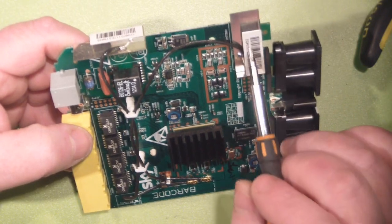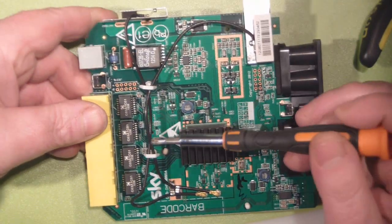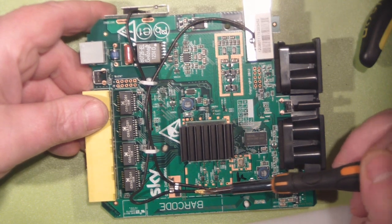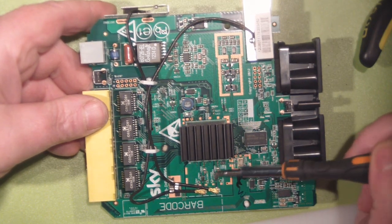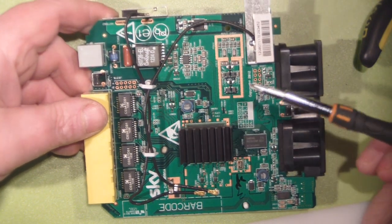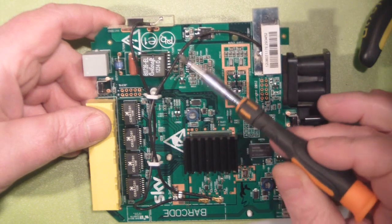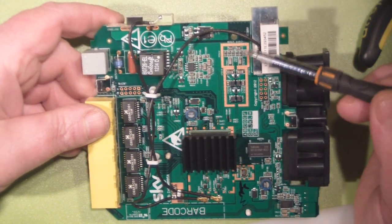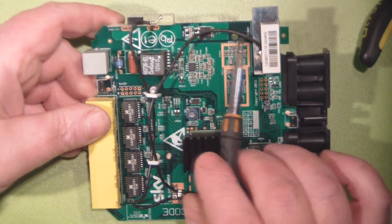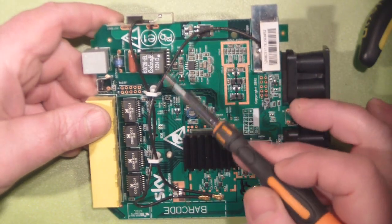You've got one in the horizontal and one in the vertical, so you're supposed to keep it that way up. The good thing about this is you've got your two U.FL connectors here, so we can just disconnect the LMR cable that feeds into the actual chip under here that performs all the Wi-Fi. We can just take them off and desolder them off these antennas. Then we can use this cable to either crimp on some reverse SMA connectors so we can add our own antennas, or we can solder directly and make dipole antennas connected directly to this cable.